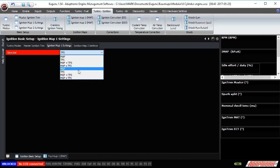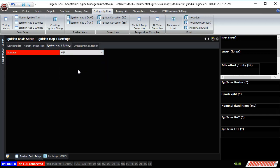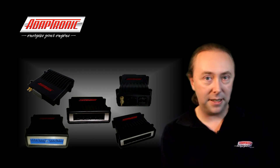We also offer MGP — manifold gauge pressure — as a measurement axis. I don't personally think this is a good idea because it's absolute pressure that affects how fast the flame propagates through the cylinder, not the pressure relative to the outside air, which is closed off anyway at the time.